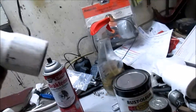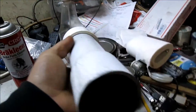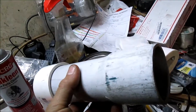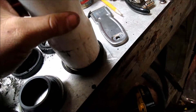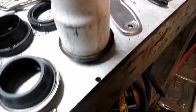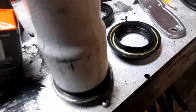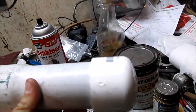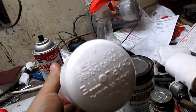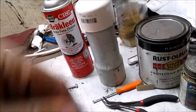Today at work I made up this little special tool for driving the seals home — just a piece of 2-inch conduit with the fat end, which is going to fit perfectly over the seal. Then on the way home I stopped at Ace Hardware and grabbed a 2-inch cap for less than 2 bucks, and I've got myself a nice seal installer.